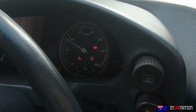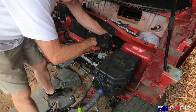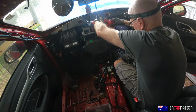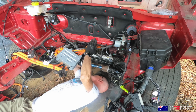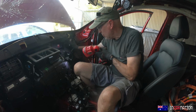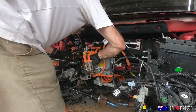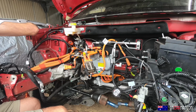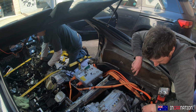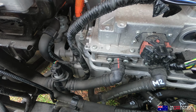But there are potentially a whole lot of showstoppers that I just can't fix, stuff that was in the MG that we no longer have in the Porsche. Much of the stability control system's gone, we don't have any steering angle sensors, there's no airbags, half the ABS system, seatbelt buckles and the pretensioners all gone, driver occupancy detection, the radar, the SOS back to base system, forward view lane keeping camera, the column mounted electric power steering, working air conditioning that it used to have to cool the battery, and the wheel speed sensors aren't even connected yet, which will no doubt send the regeneration system into a tizz. And the car also knows there's no coolant, as the coolant pumps are freewheeling with no load.